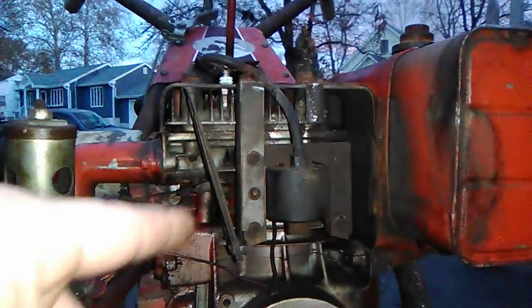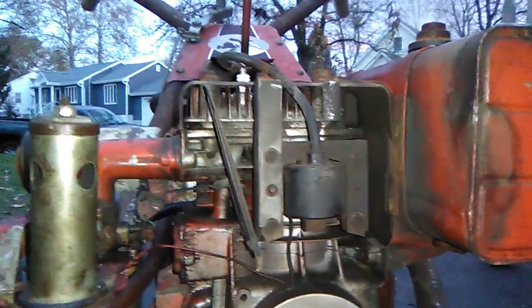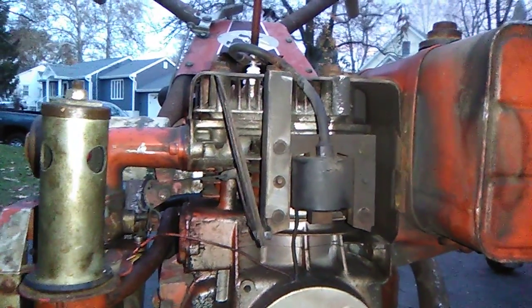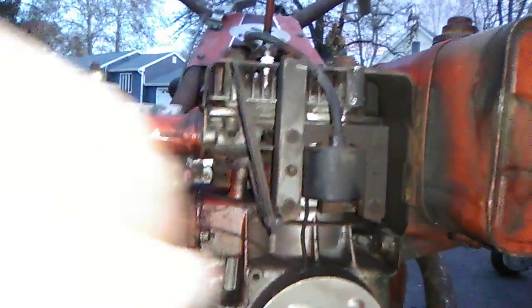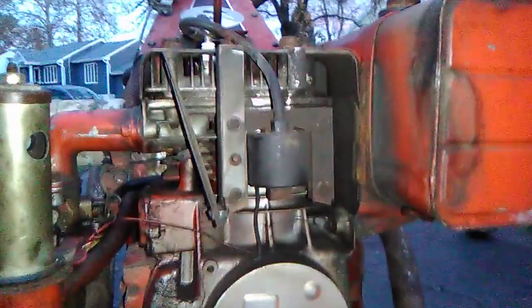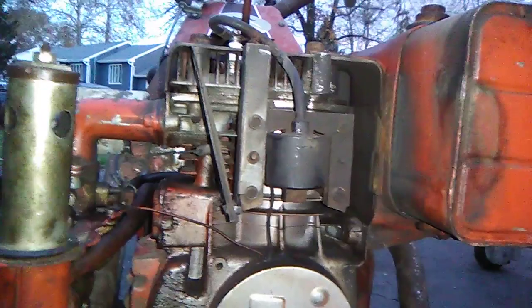In 1966 they had the modern two-leg coil, so on those ones you can upgrade. The modern magnetron electronic ignition uses that same two-leg coil, except it has a CDI built into it instead of having to run down to the points and condenser. So on the 1966 and newer engines you can just readily swap from points to magnetron.